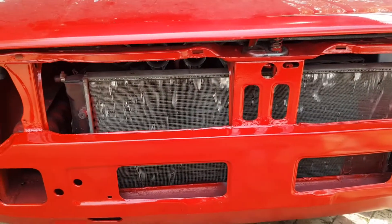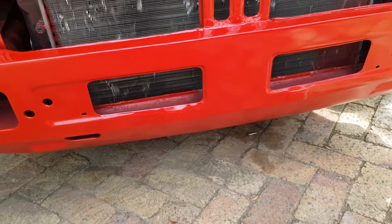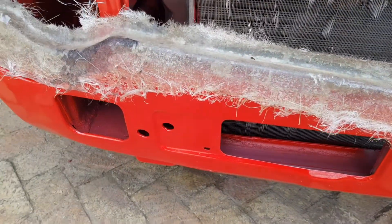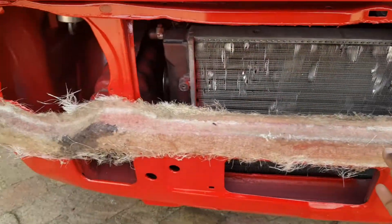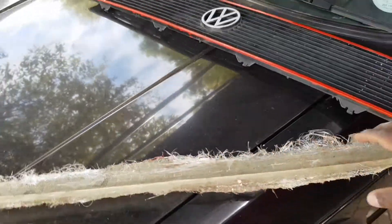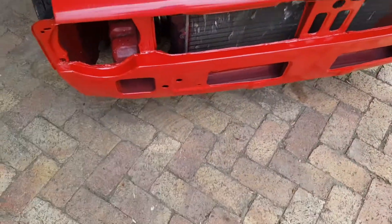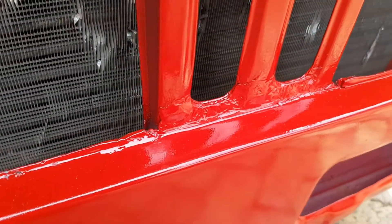What I actually did was I used the original cradle and fiberglassed the top. I made a mold of it — and this is the actual mold that I made from fiberglass. I laid cello tape along the inside to act as a release agent, then I fiberglassed inside and made an actual mold for the cradle. I then took that mold, mounted it on here, and as you can see here are the remnants of the fiberglass.